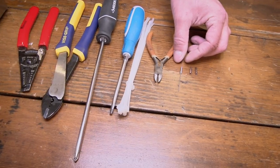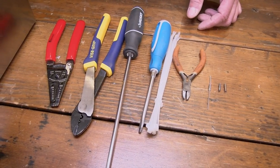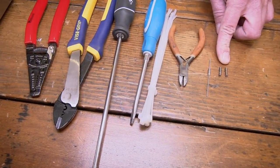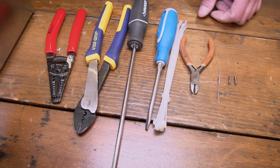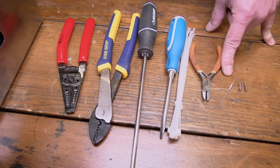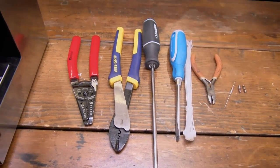And then this is what we're changing — this is the thermal fuse. There's going to be a link on the video for this. It's a DM1040, that's the part number. It comes with the butt connectors, and we'll crimp those onto the wires and then onto each end of the thermal fuse. This is what's preventing power to your machine. It's a little fuse — it's temperature regulated, so when it hits a certain temperature it cuts power right off.